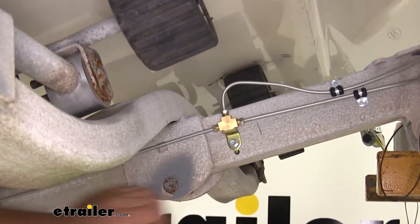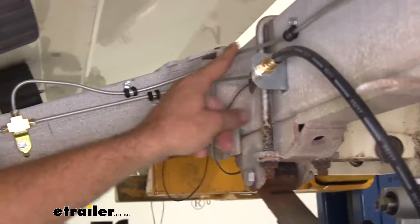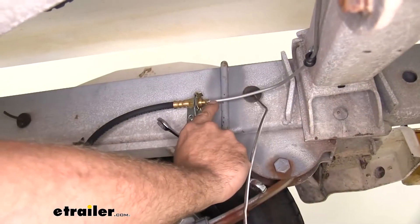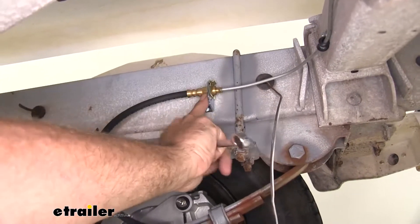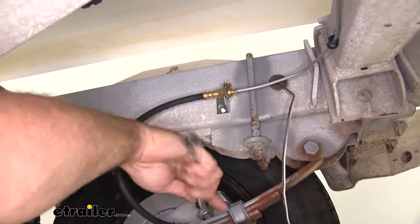For gentler angles like creating this angle here, it's something you can do by hand. For the thin hard line, you want to use a 3/8-inch wrench, and then for the larger fitting on your flex hose, that's going to be a 5/8-inch — just keep that in mind.